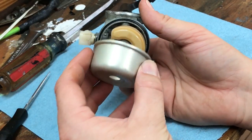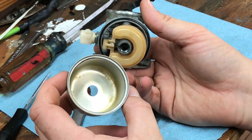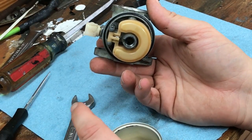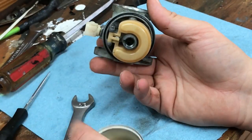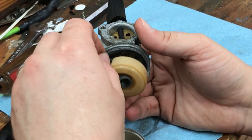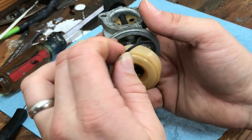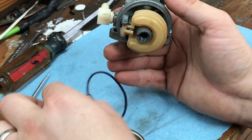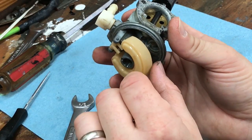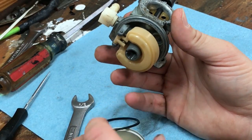As you remove the bowl, if a carburetor has been sitting a while you'll see a lot of gunk in the bottom — this holds the fuel. There's a rubber O-ring that seats on this ledge right here that seals the bowl to the bottom of the carburetor, and what you see right here is the float.